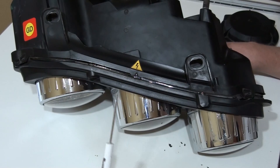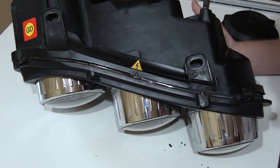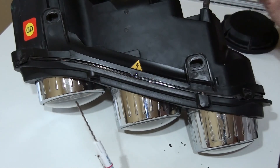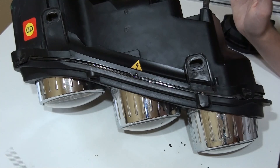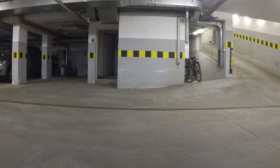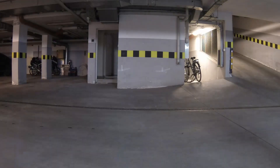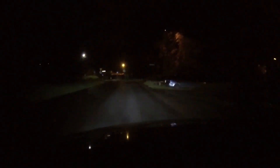Important thing: these headlamps do not have a type approval for this light source that I installed in them — we have to bear that in mind. But what I'm trying to prove in this whole project is that you can retrofit a light source into an existing headlamp that would satisfy all the type approval requirements for that kind of light source. And with the kind of equipment that you have on your car — or actually don't have, because I don't have automatic headlamp leveling, neither do I have a headlamp cleaning system. So this is the whole point of this project.